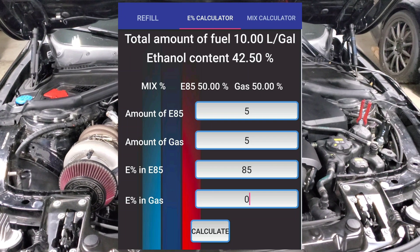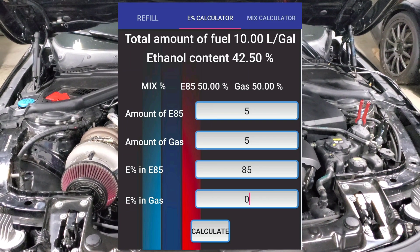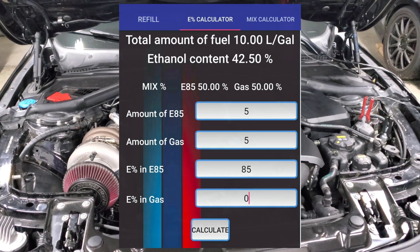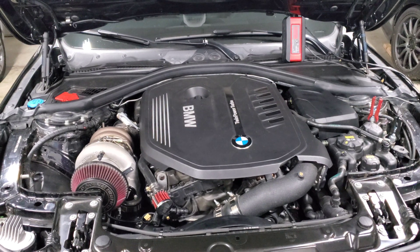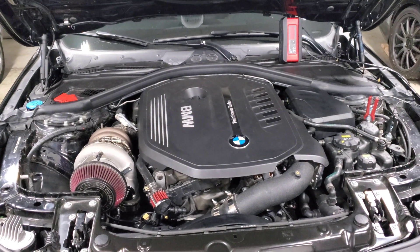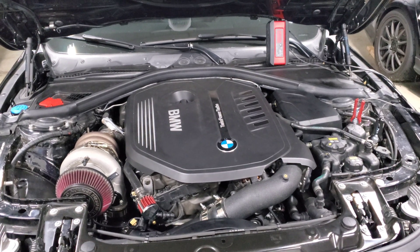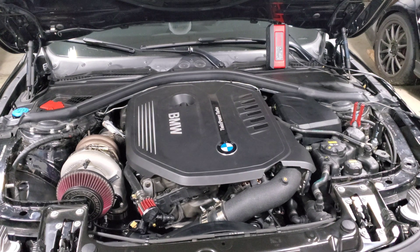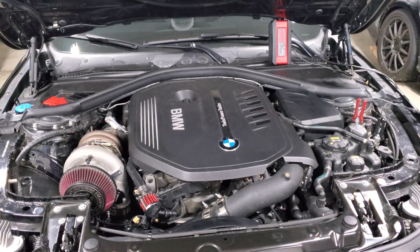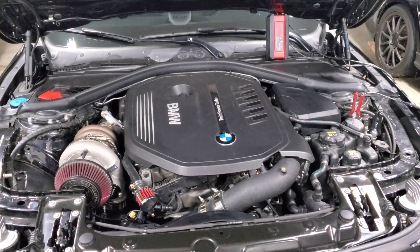When getting your custom tune on a 50/50 mix, you just put three gallons of 93 and three gallons of E85 — or five and five — and you've got your mix perfect every time. Don't make it overly complicated if you don't need to. Do whatever is most convenient and right for your setup and goals. But if you want the absolute most power output for your setup, definitely start with E30 and work from there with your tuner. I hope this video helps — thanks for watching, and leave any questions or comments down below.